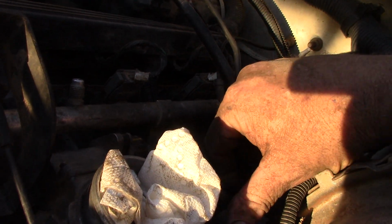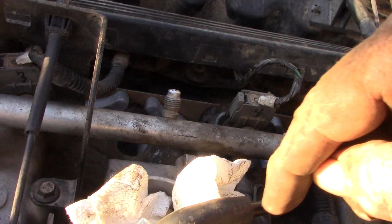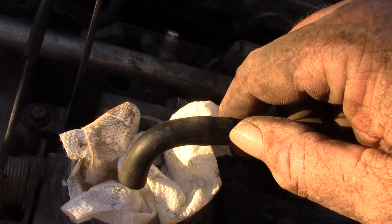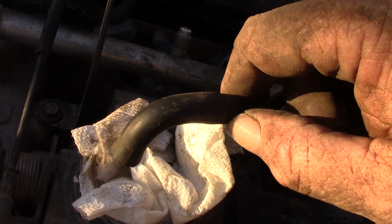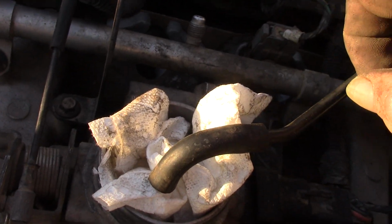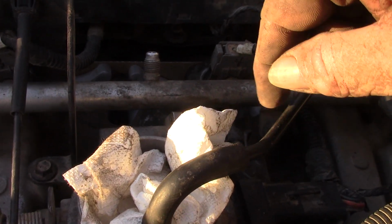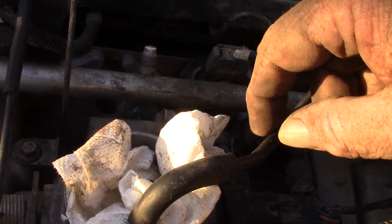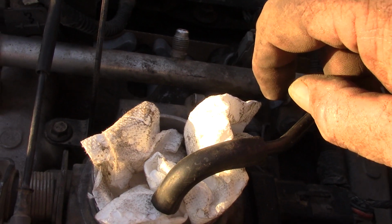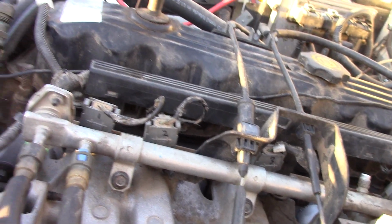This hose I'm going to replace. And one thing I'll point out, these hard lines get brittle, so you're better off actually taking a knife and slicing this off than trying to work this old plastic off, because over time these will break and these become harder to get a hold of. So if you want to keep your hard lines, cut them off with a knife and don't try to twist them off or it'll snap. So we're getting there. Keep plugging away at putting all this together.